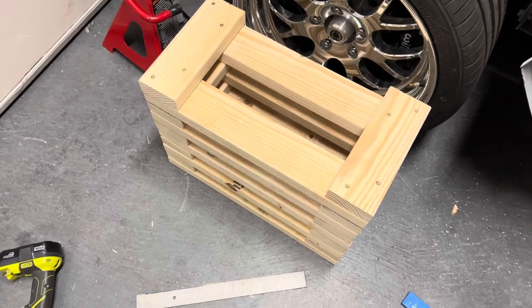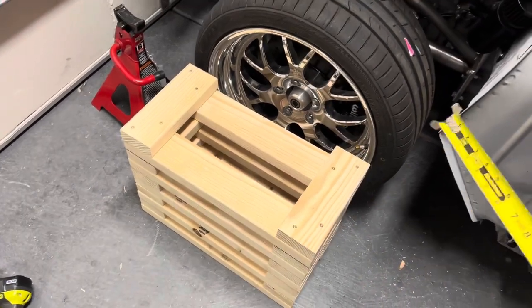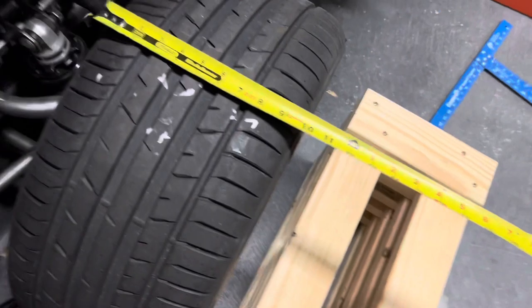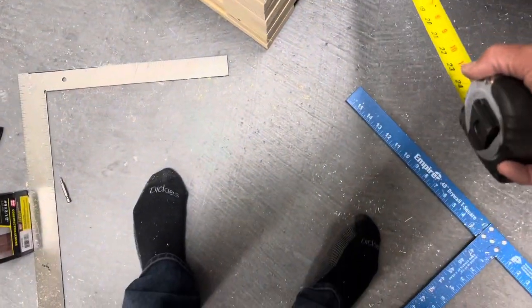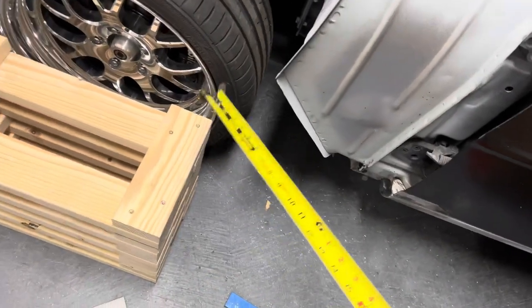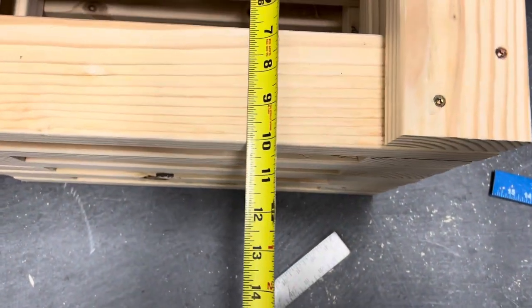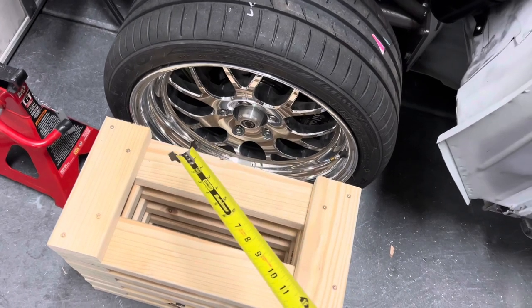I have one stand done — or wheel cribs, wheel cradles, whatever you call them. I've got a lot of lumber cut and need to run back to Home Depot for two more sticks of 2x4. The way I built it: I measured the width of each tire front and rear. The front tires are 10 inches wide. With the car on the ground, I jammed 2x4s up against the rubber front and rear and measured the overall distance between the far edges — that came out to 20 inches long by 10 inches wide. The tire sits in the middle and the front and rear stop it from rolling forward or backward.